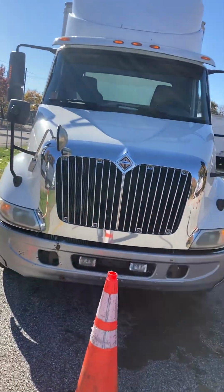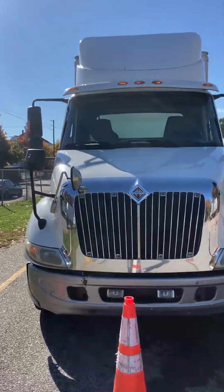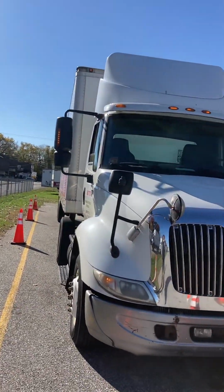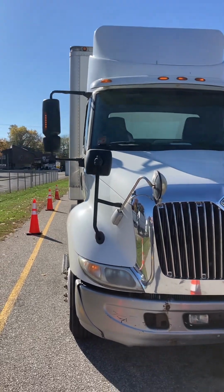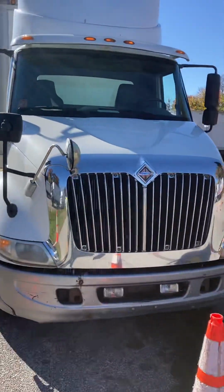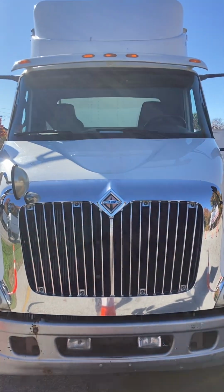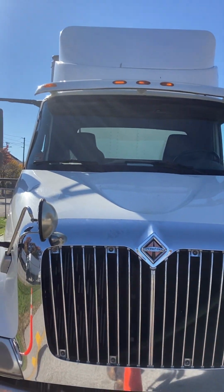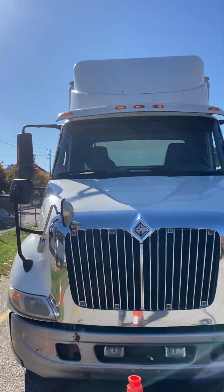We're here for the Massachusetts pre-trip inspection for CDL Class A. We're going to start off, normally we don't have that wind visor thing up on the top, but we're going to start off with our trailer marker lights on the top. Amber in color, clear, no cracks, properly working. We're going to talk about our tractor cab corner marker lights, amber in color, clear, no cracks. Our 3 ID lights in the middle, amber in color, clear, no cracks, also indicating 80 inches or wider.